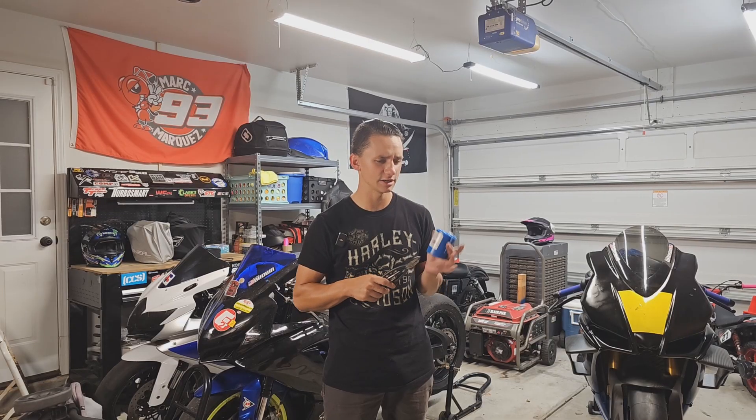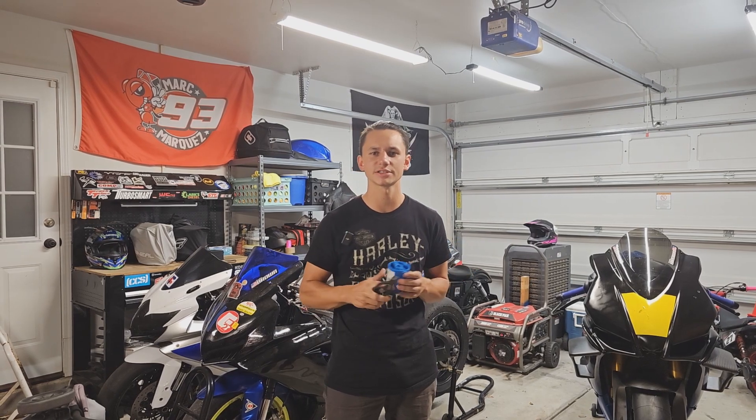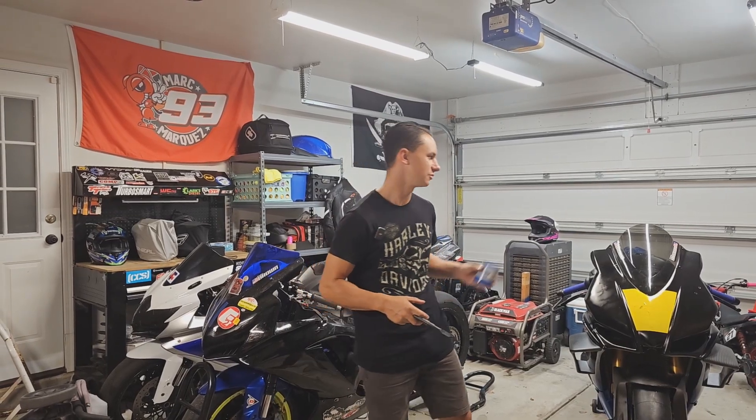The specific size that I got was 32 thousandths of an inch, or 0.81 millimeters. Bought it on Amazon — I'll have a link down in the description. You can get one pound of it for 20 bucks. 32 thousandths is pretty much the perfect size for everything on a motorcycle. The standard is you want to go for the biggest size that'll fit in the hole, but if you're drilling the hole yourself it gets a little awkward, so 32 thousandths is plain strong enough. I would say you could go down to 28 also, but that's the safety wire.